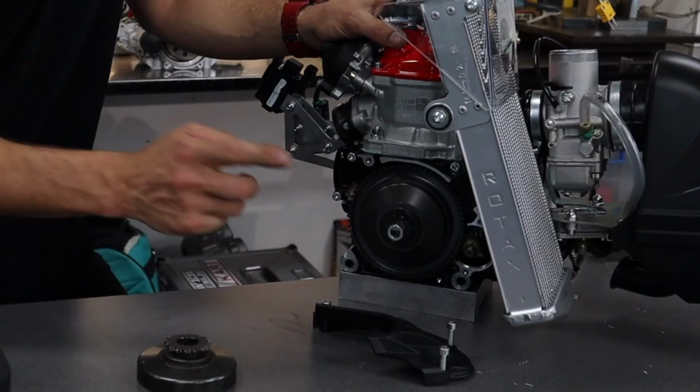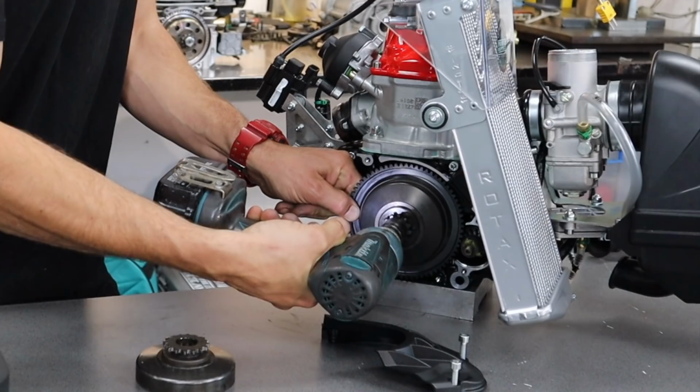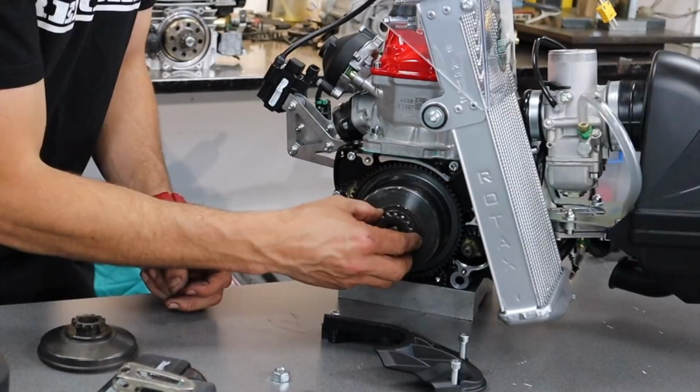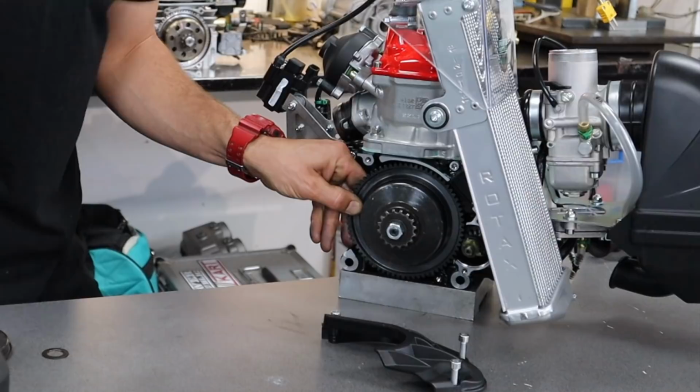After you have removed the clutch cover, we're just going to whiz off this clutch nut. The factory definitely uses a fair share of Loctite there. And put the bearing back on. Run the 16 retaining nut, washer, retaining nut. Just buzz that back on. And we're good to go. Reinstall the Bendix cover, and it's ready to go on the dyno.